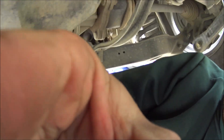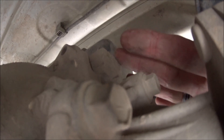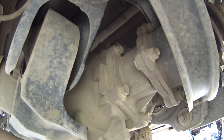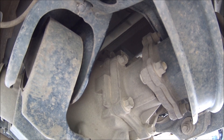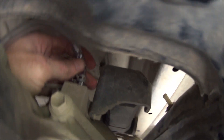I'm under the back now. I've already removed the back hose earlier. The factory hose comes off the top of the diff and then goes back up to a plastic mount on top of part of the suspension housing - not sure what that's all about, it wouldn't really protect anything. I'm going to get the hose on there, push it down onto that barb, then run it up under the back of the car or along through the chassis rails and up high in the engine bay. The back diff is a bit of a bugger to work on because it's up high. It's maybe a half hour job to get your hands in and around and run it, but it's well worth doing.